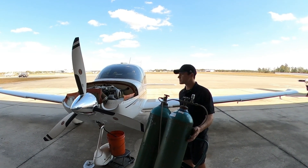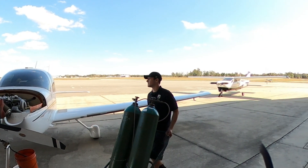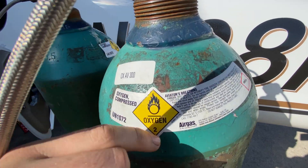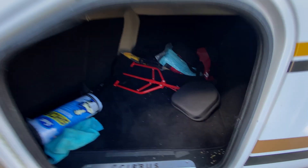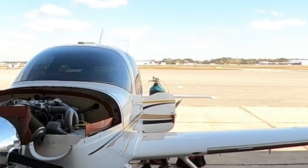There are the oxygen bottles. We're going to service the breathing oxygen — it says 'aviators breathing oxygen' on here. We've got compressed oxygen and aviators breathing oxygen. Oxygen bottles are never in the same spot unless it's the same airplane. This one has its oxygen in the back. Pop this little cover off — it's pretty much full. We just need it up to the green, which is 2,000 PSI.